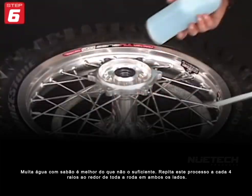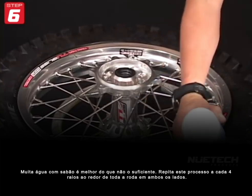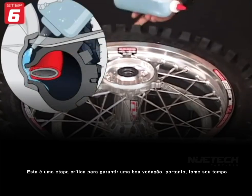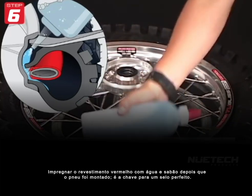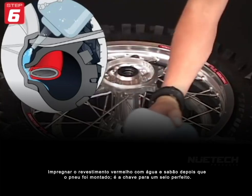Too much soapy water is way better than not enough. Repeat this process every 4 spokes around the entire wheel on both sides. This is a critical step to ensure a good seal, so take your time. Saturating that red liner with soapy water after the tire has been mounted is a key to an airtight seal.